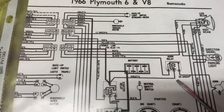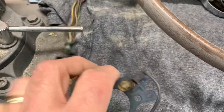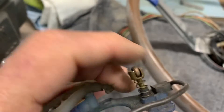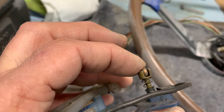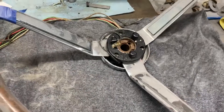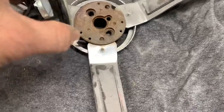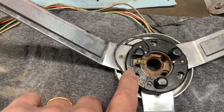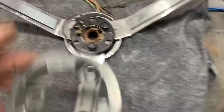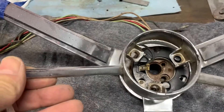Where does that black wire come from? It comes all the way back to your signal switch, to this wire right here. This is a little copper wheel, spring-loaded, because it sits on the contact ring on the back side of your steering wheel. It doesn't matter if you have a standard steering wheel or a sport wheel — it's the same. That is connected with a wire up to your horn switch.